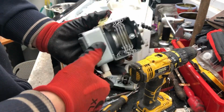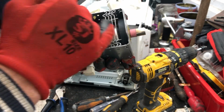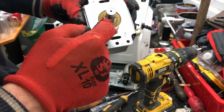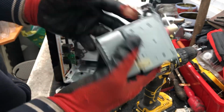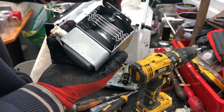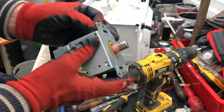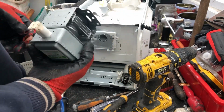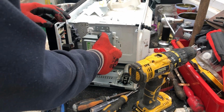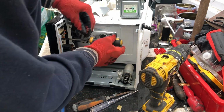Some people take the magnetrons apart to get the two quite powerful magnets, and inside that middle part there is copper as well, and a bit of brass normally. But I don't take this apart, because there are parts inside, some of that pink stuff, that if you break it in the dust and breathe it in, is poisonous. So I personally don't mess with these. A lot of people do go through them. Maybe in the future when I've got a decent respirator I might, but I very much doubt it. Health is worth more than just going for the extra bit of copper.